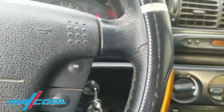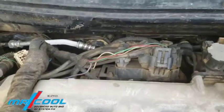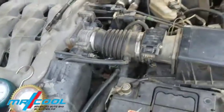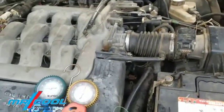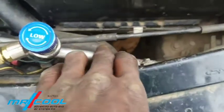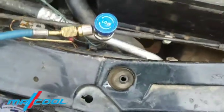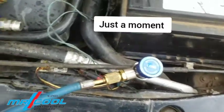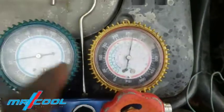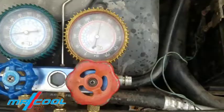Let me tell you how to solve this problem if you have it. There are a lot of things that can actually cause it. First is poor airflow. Over here you can see it right there — I can still see it. So here at my suction side, when you have this kind of problem you can see it right there. The first thing I want you to do: I just created this scenario so I can lecture you guys. Look at my pressure gauge set — the refrigerant is higher than it's supposed to be.